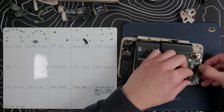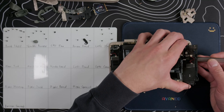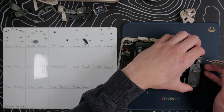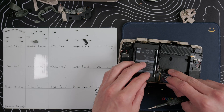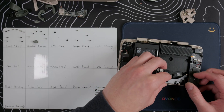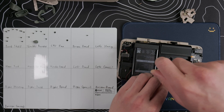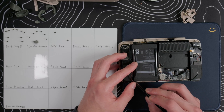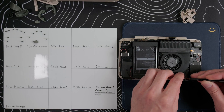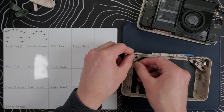Press the big Wi-Fi daughterboard ribbon cable back into place and then put the left housing into place. This left housing can be a bit of a pain since you need to feed this smaller ribbon cable through the hole on the housing. It can require some finagling with tweezers to get it through, but once you pull it through you can set the housing into place. The analog stick cable goes on the left side of the housing, not through any hole. Put in the six screws, making sure to use these holes, and then reattach the two ribbon cables on the housing. Put the SSD back and secure it with the clip. Pivot the Wi-Fi daughterboard housing and put in the three screws, then put the Wi-Fi daughterboard on top, put in the two screws, reconnect the Wi-Fi antenna cables first and then the right speaker cable, and tuck both cables into this part of the frame. Put in the cooling fan and the two screws and then reconnect the cable. Reattach the black sticker on top. Put the custom buttons back into their slots and then reinstall each shoulder button housing and put in the three screws on each side.